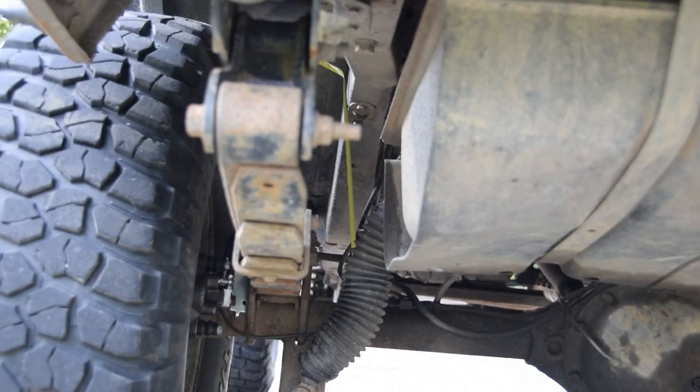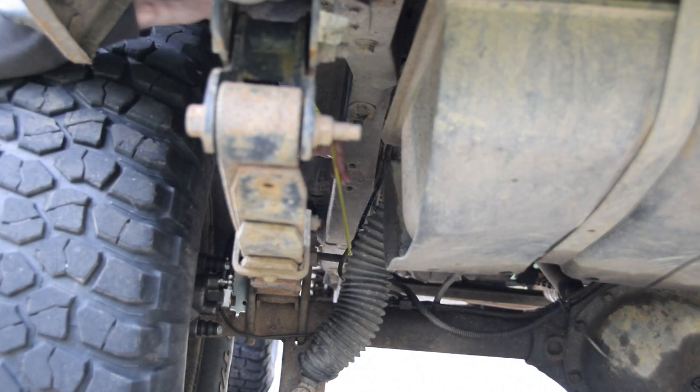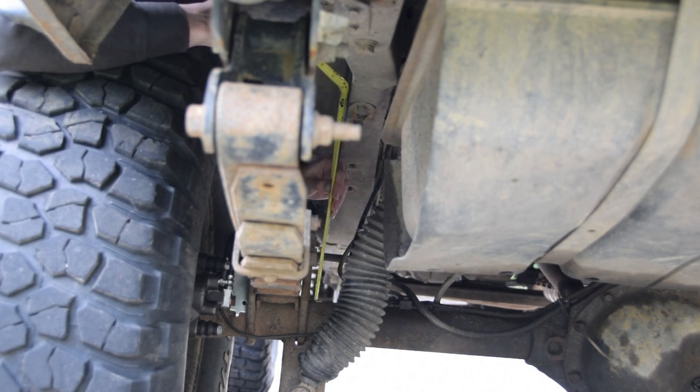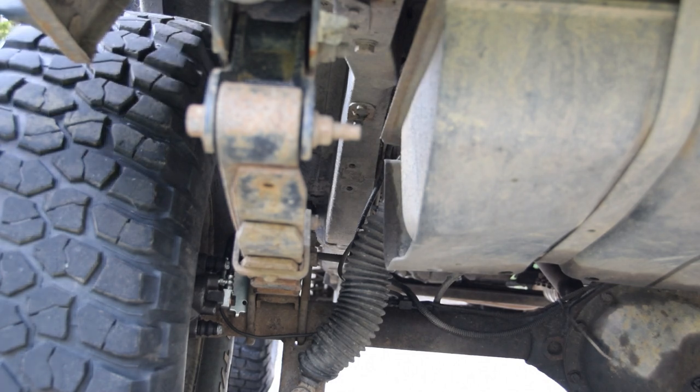The next part is going to be on the back. I find this easier on the driver's side. We're going to measure from the top of the axle tube to the frame rail. Now, if you have a Chrysler 8¼ or possibly a different axle, the axle height does matter. So you may have to add a certain amount extra compared to what the Dana 35 was — I'll see if I can look up those numbers later. We're going to come back here and go from the top of the tube up to the frame rail. And we're looking at about 11 and 3 quarter inches in the back.